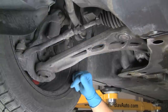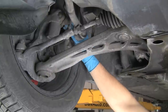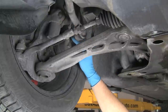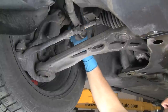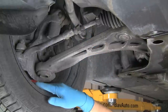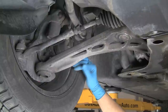While we're under here, take a good look at the brake caliper and the hose running through and up into the body. Make sure you see no brake fluid leaks and that the hose has no cracks on it. Any cracks on this hose and it should be replaced immediately — you're talking about losing your brakes. Look for any signs of grease on the inside of the wheel or brake fluid anywhere.